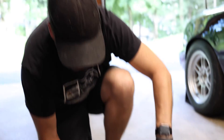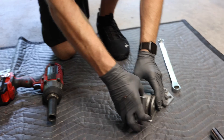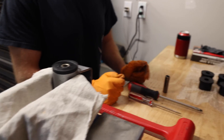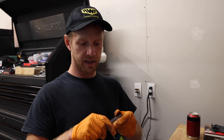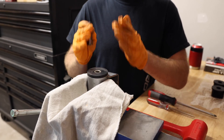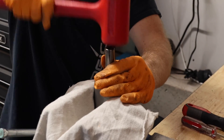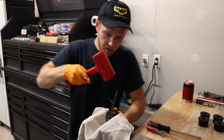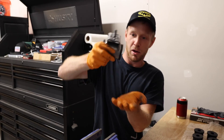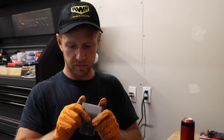We're separating the mount itself from the bushing and the bushing seat. Those are 19mm on both sides. AWR gives you a lock nut, washers, and everything. To get the sleeve and bushing out, a good method from AWR is to use a half-inch socket. Put the motor mount in a vice vertically, place the socket over the hole, and hammer down to drive the center pin out.